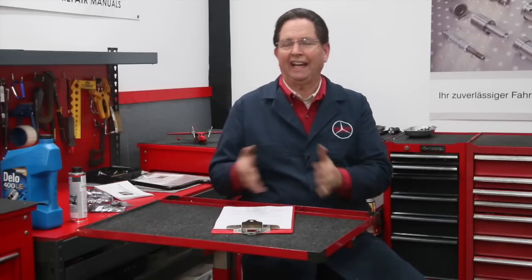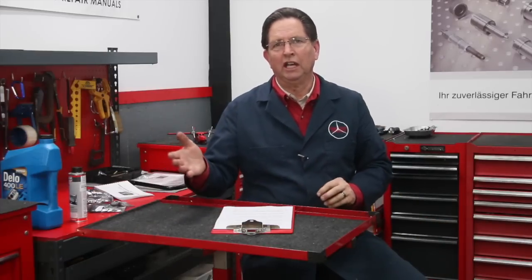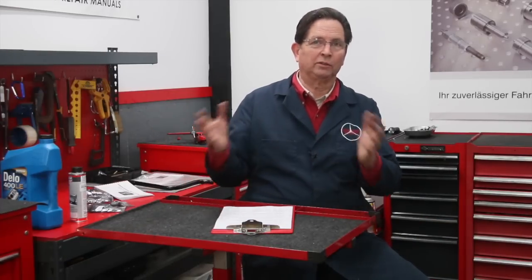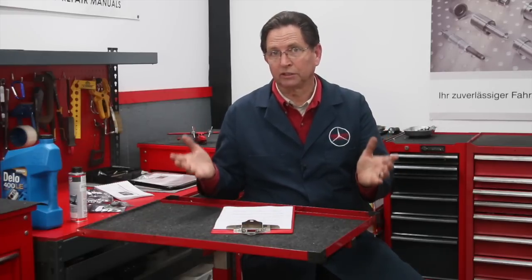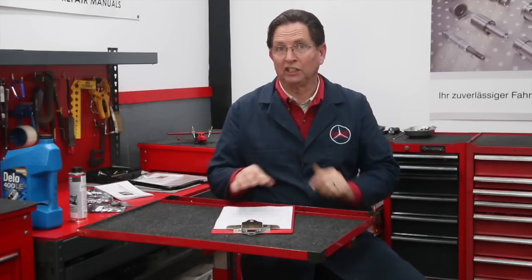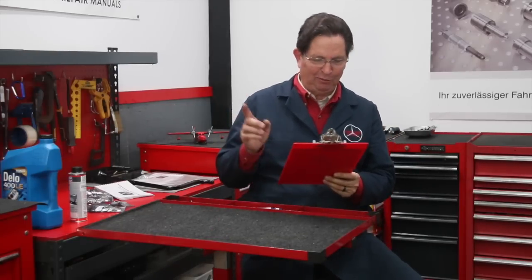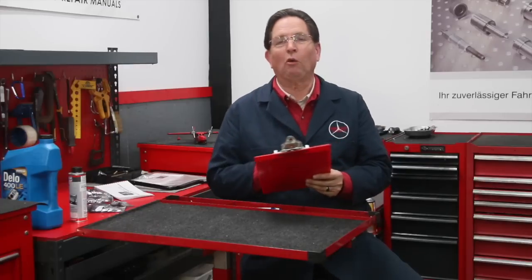So there's a lot of factors. Once you determine you have a good solid strong engine internally, then you can start looking at fuel injectors, injection pump timing, and other issues I cover in my manual. I hope you find that helpful — I know there's no simple answer. A diesel purge may help a little bit, but it's probably not going to solve the root issue if the engine has quite a few miles on it and hasn't had a lot of preventative maintenance done.